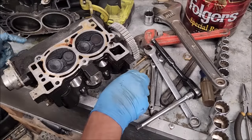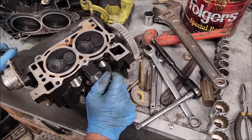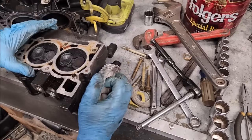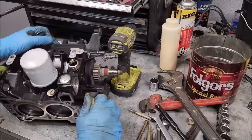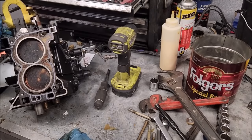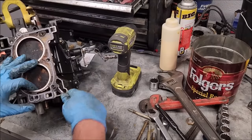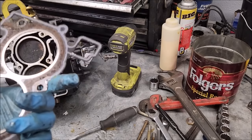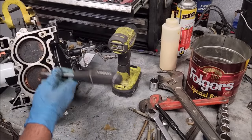All right, cylinder head is off. Nothing weird. I have one oily, watery, milky bolt out of this top corner. Well, the rest of them look clean and fine. So perhaps the head gasket. Typical carbon buildup. Nothing I would say is unusual. Gasket. Don't notice anything right off the bat. Don't see any cracks in the gasket. No crack between the cylinders, outer cylinders.